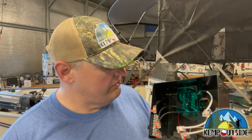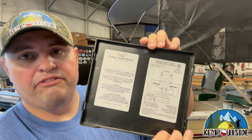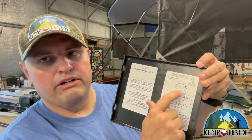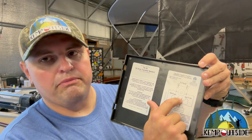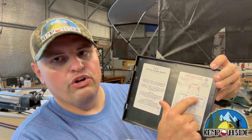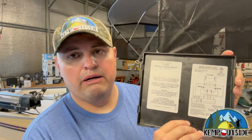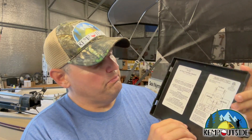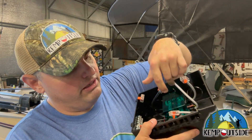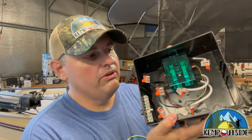All you've got to do is run your wire into the box, put your bare wire in the end, clamp it down, and you're connected — really simple. To show you how to hook this up: the terminals up top go to your breaker panel in the trailer, the two on the side go to shore power or generator, and the two on the bottom come from your inverter. Normally it runs off the inverter, and when it detects shore power, it transfers over with about a 20- to 45-second time delay.